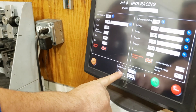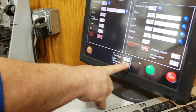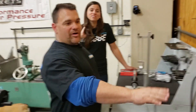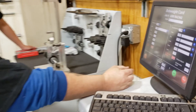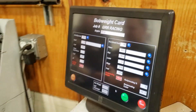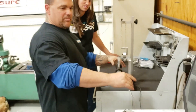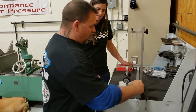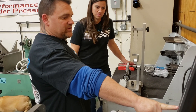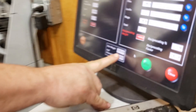Our total weight on our reciprocating side is 1,494.8 grams times 50%, which gives us 747.38 grams. So our full bob weight is 1,751 grams, with a half bob weight of 875 grams. We have our bob weight and our half bob weight. We're going to make our bob weight with all the nuts as if bolted on the crank — we need it to weigh 1,751.59 grams.